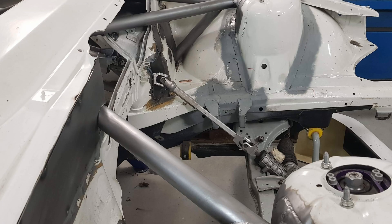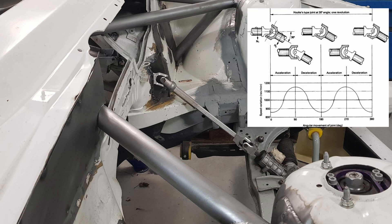This is how we phase the universal joint connecting the column to the lower steering shaft when the wheel is in the straight ahead position. Since there's a pretty large difference in rotational speed every 90 degrees when using a universal joint at an angle, it's really important that the universal joint is phased correctly so that you don't get asymmetric steering behavior whether you're turning left or right. We currently have it mounted so that the steering ratio is faster on center than off center, but we'll be testing this and most likely rotating the universal joint 90 degrees so that we have the faster ratio off center for better response while cornering.